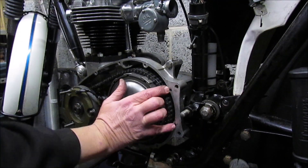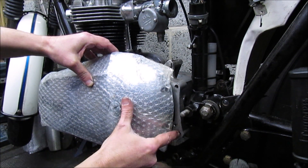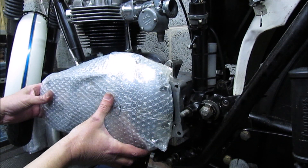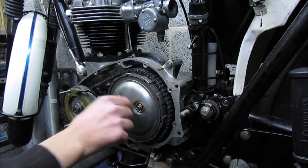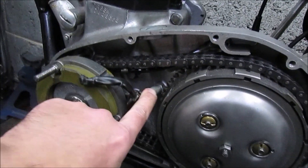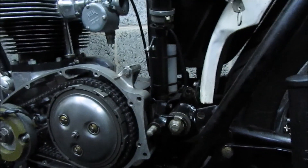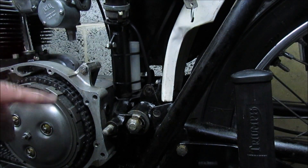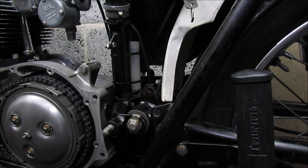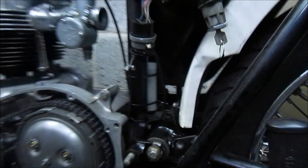Actually I don't think it does. These are the two screws that go through the primary, and it's these two bolt holes that I need for the actual footrest bracket. So that's good - I can leave that off. That was the pipe that I've screwed in, that's now tight. Also going back to the last episode with the speedo cable, I have now re-routed it. I had to take the footrest bracket off and feed it through - it was coming round to this side so I had to feed it over on the opposite side. So that's now done.